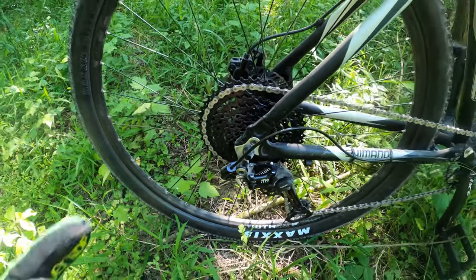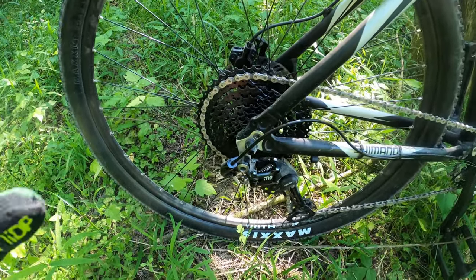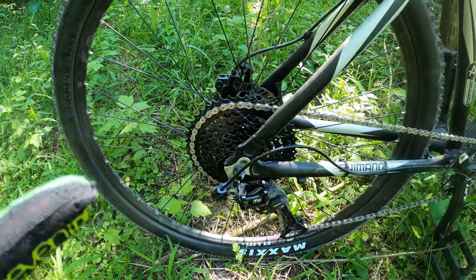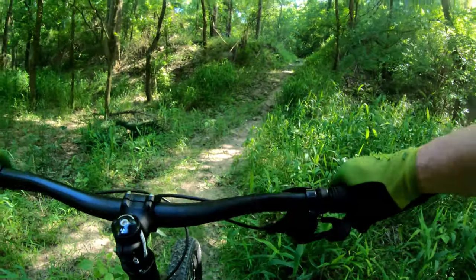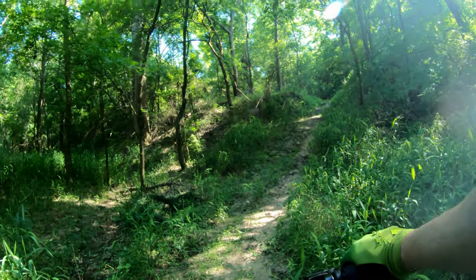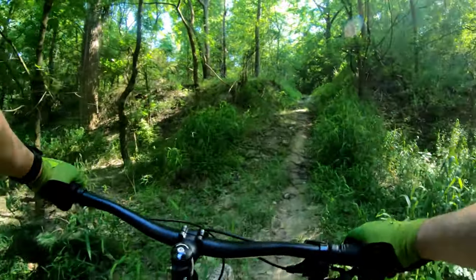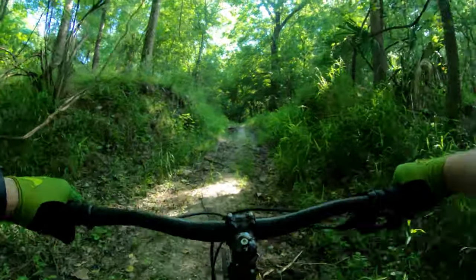So far I'm leaning towards the Advent — it just feels better. Another thing I don't like is when I'm in the lowest gear it still acts like it wants to push even though I adjusted the limit screw. There's still some play in there which I don't care for.